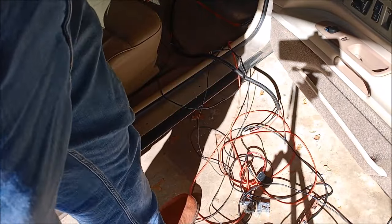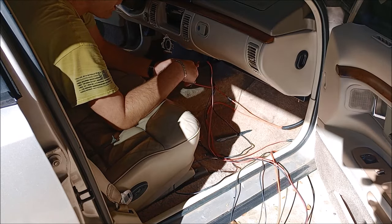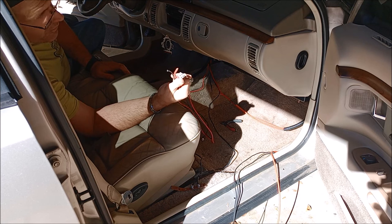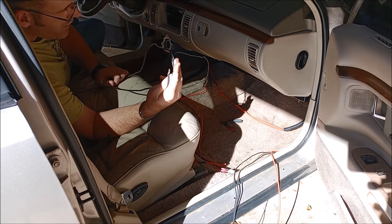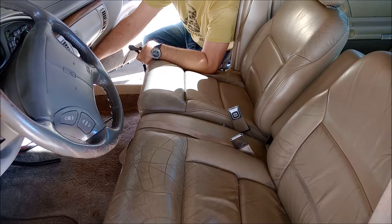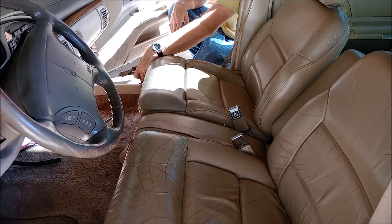So all this right here, battle, is the wire loom I removed from the car. These two are the most important — antenna tuner power. This right here is for my radio: power and ground for my radio, plus a ground that goes right into the back. I also had ground to my radio, which was a single point going to the bus bar. This is power and ground from the two switches under the dash. A good fuse, a good battery terminal. Now we're down to just a few stray wires, and I'll remove part of this dash to get those switches, then get the head unit and put the OE head unit back in it.